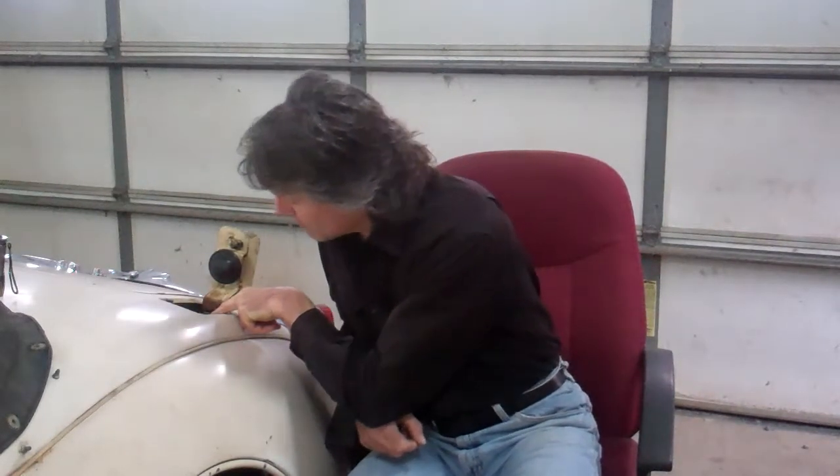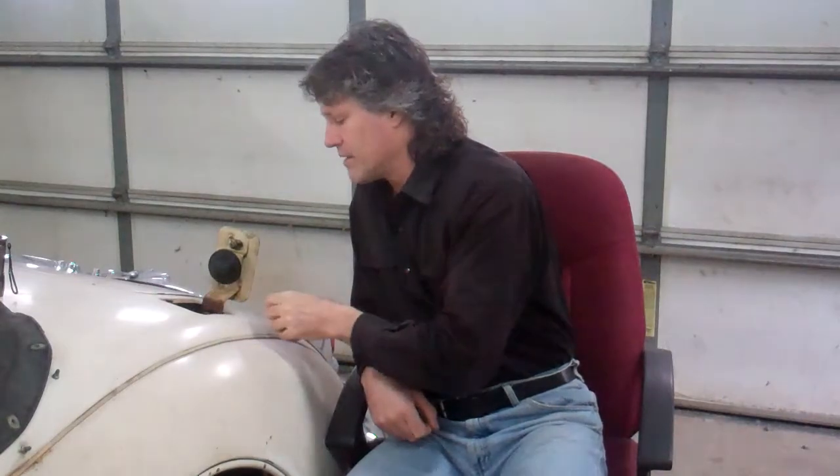It's got to have it. In the worst case scenario, if the tank is full and you do a burnout and all the fuel flies up the filler neck, it's just going to go inside this little bulkhead here and drain out of that port there that leads to the inside of the fender. No harm, no foul. That's the vent. And if it rains, it's up above almost three-eighths or half an inch from the top of this, so the rainwater can go in, go down the discharge hole, and still vent without filling the gas tank with water.